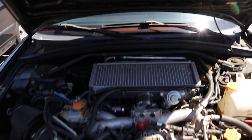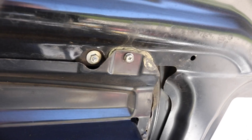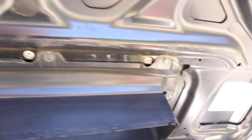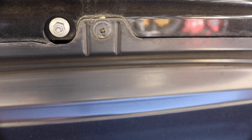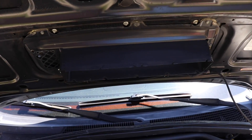The first thing we're going to do is come in here and take off each one of these 10 millimeter bolts — you can also do a Phillips head. There's three down here and then two up top, and you also have a Phillips head little plastic screw that you need to take out. Once we get all that out we can get the splitter off and then we can get the scoop off.